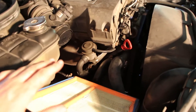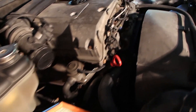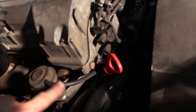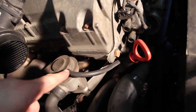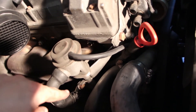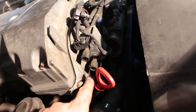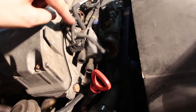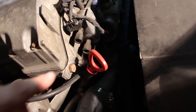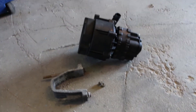If you're waiting for a replacement pump and need to drive the car in the meantime, simply unplug the bottom solenoid — that's what feeds the vacuum line. Leave all the vacuum lines and the air hose connected. By unplugging the bottom solenoid, no vacuum gets drawn, so exhaust gases won't come out. Just secure the wire so it doesn't get caught in the fan, put the cover back on, and leave it disconnected until you get your new pump.